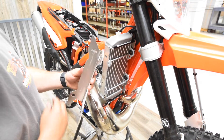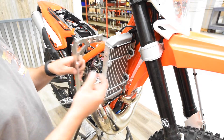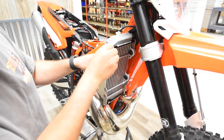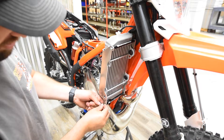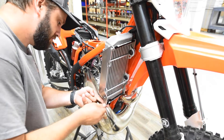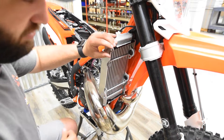Since we're on the right side, take the outer plate labeled 4220R2. The arms on the back go behind the radiator so the two mounting holes to the rods line up. Take two M6 by 16 button head bolts and get both started by hand on both radiator brace rods. That way you can make sure they're lined up before taking the 4mm Allen wrench and tightening them down.